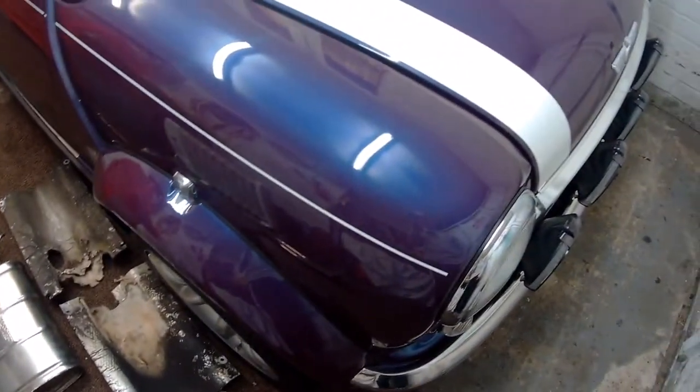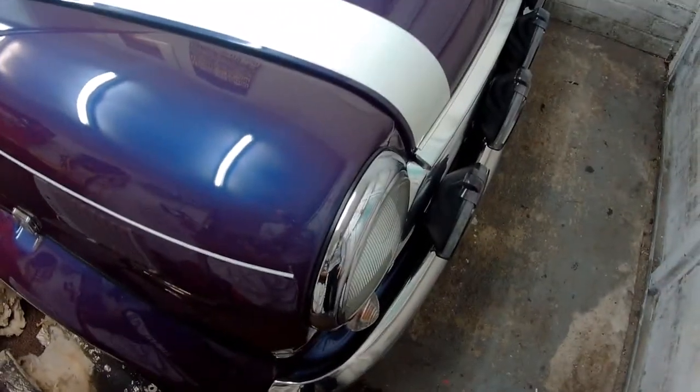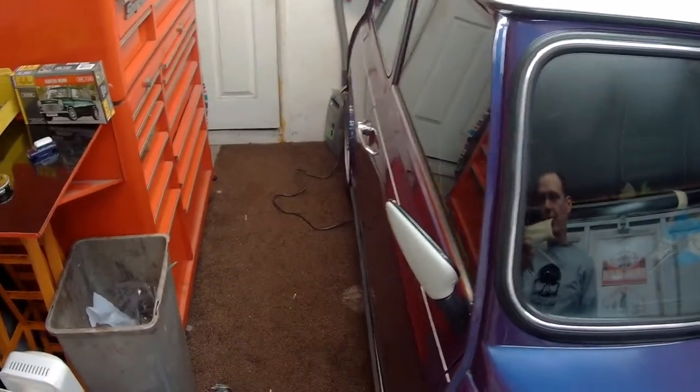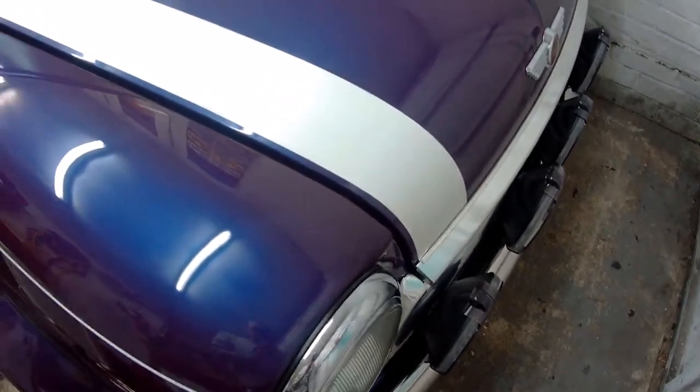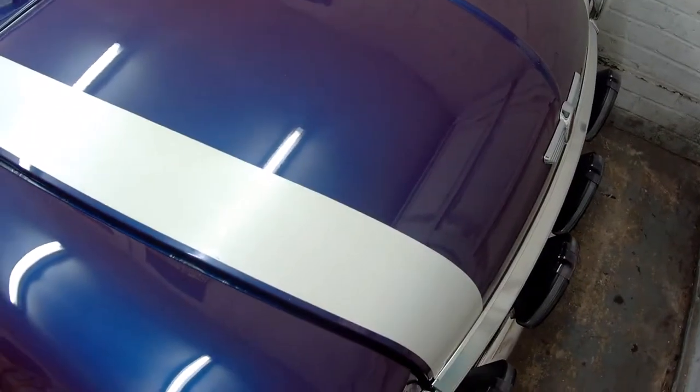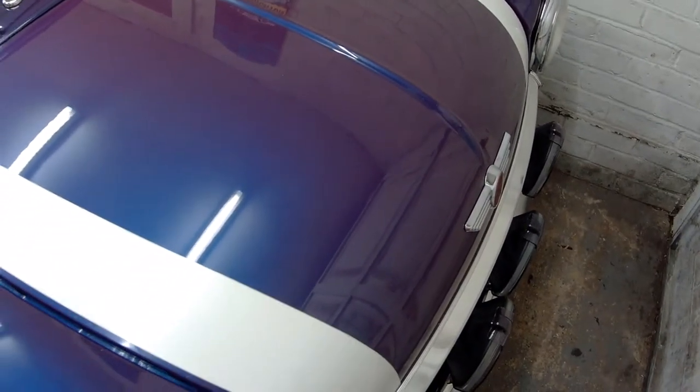We're really into the final stages now. One result of the work I've been doing: one of the first things I did was take the bonnet off, and it went into the little study room beside my garage and just sat on the sofa. I sprayed under the bonnet and even though the car was completely covered and the door was shut, some of that overspray must have leaked through the gaps in the door and covered everything with just a fine layer of lacquer overspray. If I run my hand over the bonnet, it's rough as anything — it feels horrible. You can't actually see anything in the paint but there's just a layer of lacquer on there, compared to the top wing which was covered by paper and is pretty much okay.